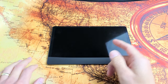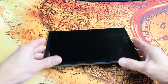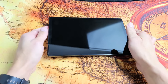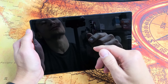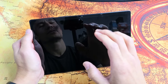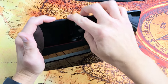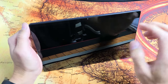If you're still stuck in a boot loop, grab your tablet and go to your freezer. Put it in the freezer where it's nice and cold and leave it there for about 15 or 20 minutes. After 15 or 20 minutes, take your tablet out. Sometimes as you pull it out, you'll notice that your boot loop is now gone and everything is working properly. If still stuck, force restart it — power button, volume down — press and hold until the Samsung logo appears, then let go.